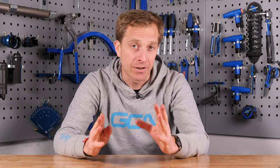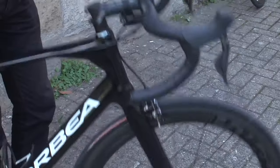One thing to consider: if your headset has been rattling for quite some time, it's likely that the bearings are now useless. You may get a little bit of extra life out of them, but ultimately it's worth replacing them. Each time the headset has been loose and you've hit a pothole, that impact has really been amplified due to the lack of compression from the top cap. So have a look at replacing those bearings.